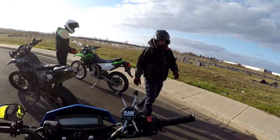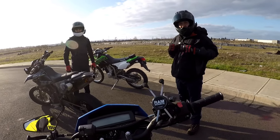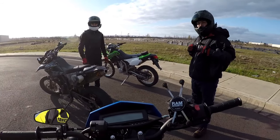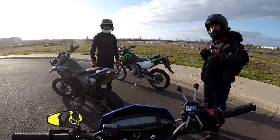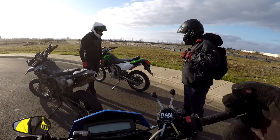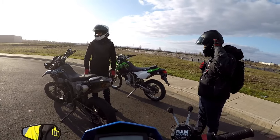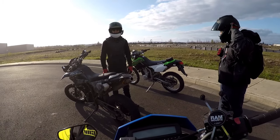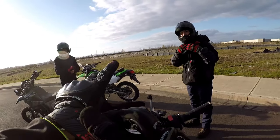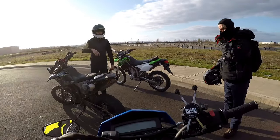I like them both. This one feels like it has more punch — you have the lid off, but it still kind of feels like even with the lid on it might have a bit better low end and mid-range, because that's apparently what they tune it for — better low-end grunt out of corners. The Dual Sport is kind of high-strung, more legs for the highway. But yeah, this has an inch more at both ends, but the Supermoto is stiffer and the rebound is a lot more controlled.